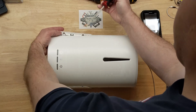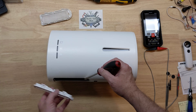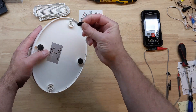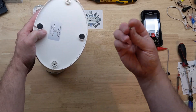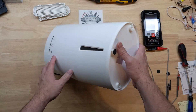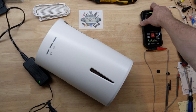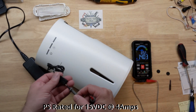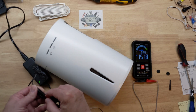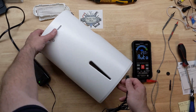First I'll pop out the little side vents with a screwdriver — pretty easy. There are also some little pads on the bottom. Just the two side ones have screws, and I've already taken those out to save time. They're just Phillips, like number one Phillips. Before I go further, I want to show you the power supply output. I've checked it off camera and we've got about 15 volts — the power supply is all good. The power light even comes on when we hook it back up.